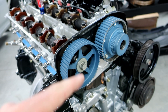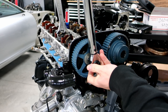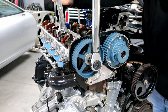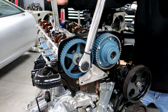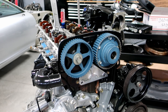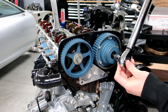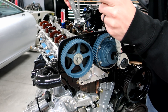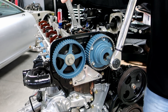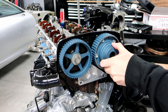Both cam gears are cranked down to 60 foot-pounds. We're going to start with the non-VVTI side first. I've got a wrench back here and I've got this torqued down to 60 foot-pounds. Now we need to move over to the VVTI gear and crank that down. We're going to remove our hex and move back over to our keyway style, put that in, and get that back on the cam. I'm just holding the cam as best as I can — now that's nice and tight.